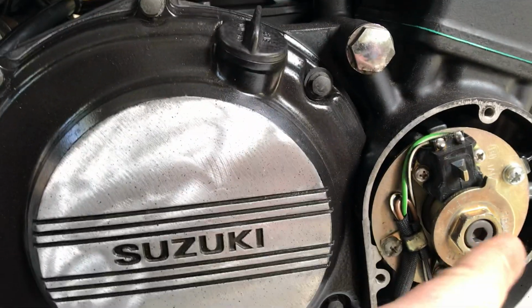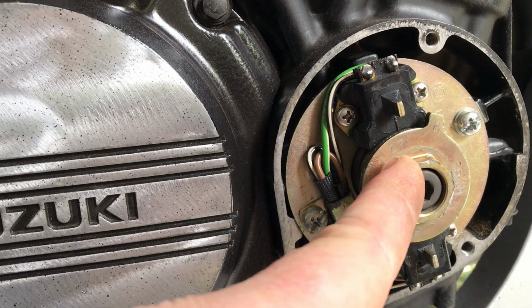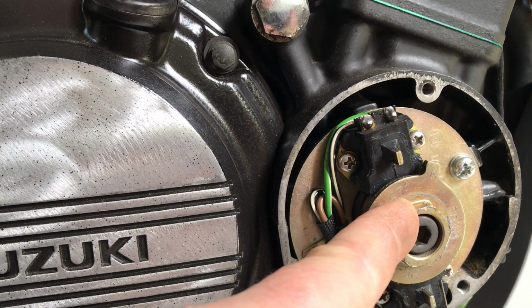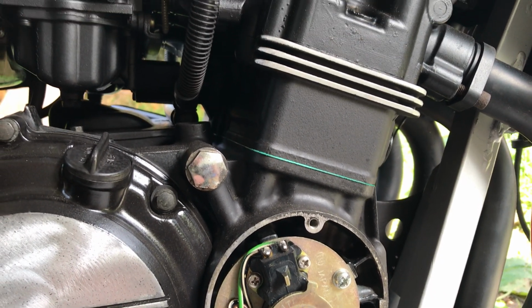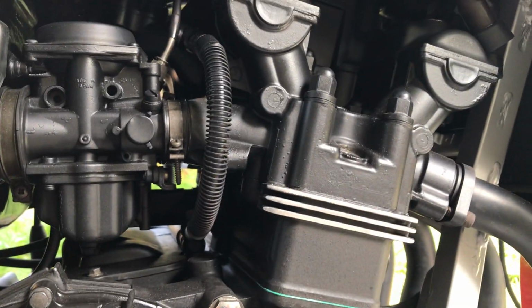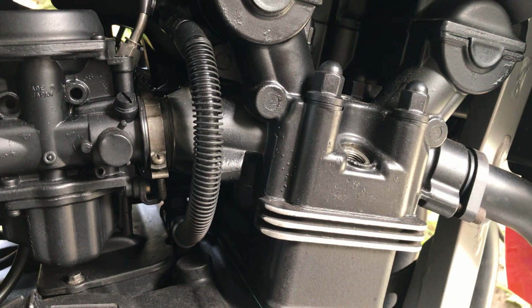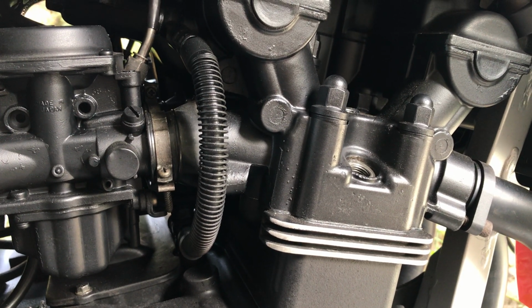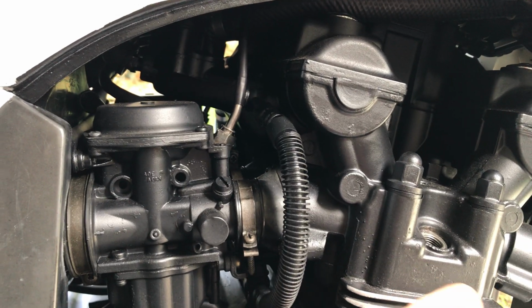Put the pistons on the firing mark. In my case, it's 1.4 T. That means piston 1 and 4 are on the top dead center. I only had to do the test on piston number 4 to conclude that all of them are the same. You put pressure in the piston and then you listen in 3 spots.